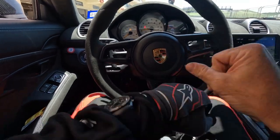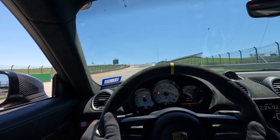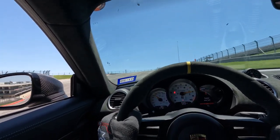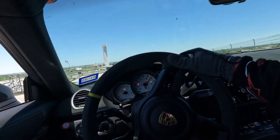Okay. So we did that from a setup standpoint, all in an effort to try to get the 305 bigger tires. Now, for the first session that I drove the car, I have not driven the car on 305s. You have. I drove it on the 295s, and I could feel it stepping out. That's when Cameron drove the car. You have since gone to the 305s, and do you feel like that has solved the stepping out issue you felt like you were having through the carousel section, some of the stadium sections, that kind of stuff?